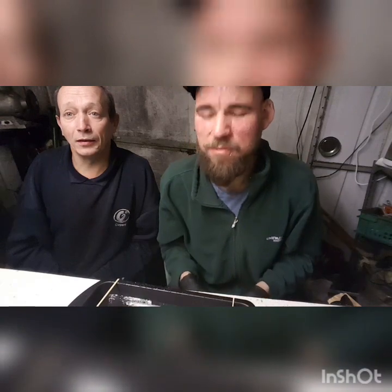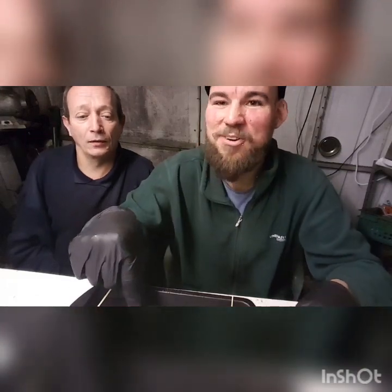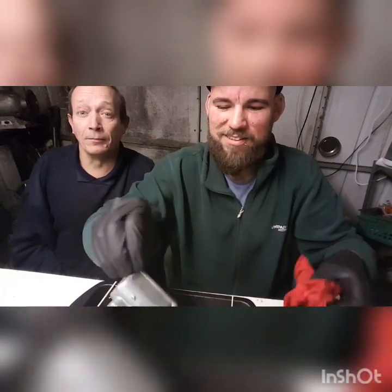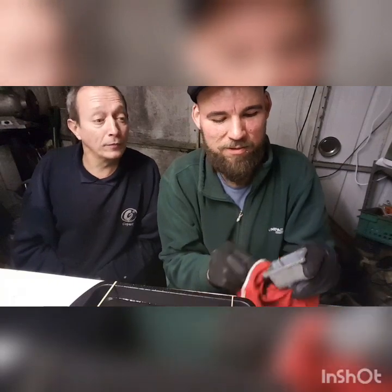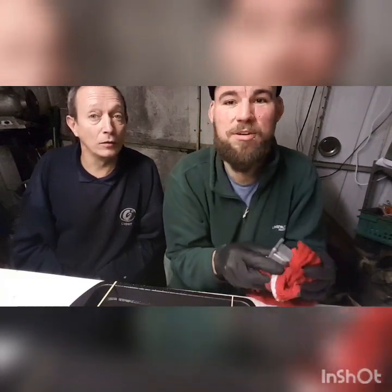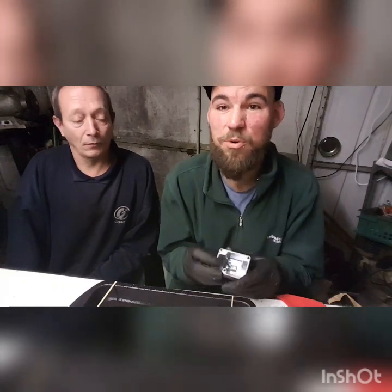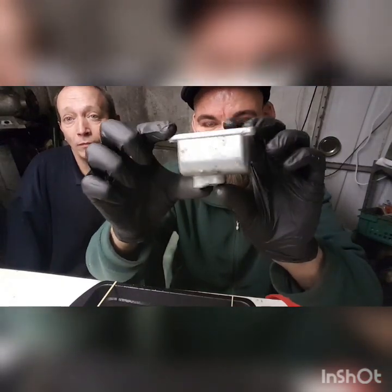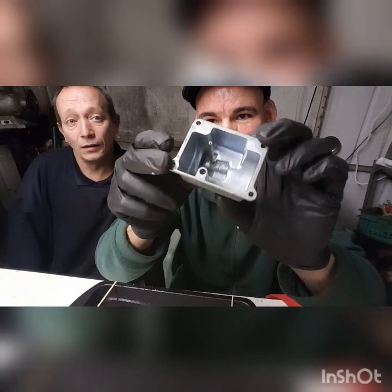We're about 25 minutes in now. It's quite a quick process, but if you want something done you'll have to wait for it. We're going to turn the massager off now. That sports massager has been running at a moderate speed — it is variable. Also watch which one you buy, because some take unusual batteries. Ours just take standard double A. But check out these results — look at that float bowl now. Like new. That is 25 minutes at moderate speed on a homemade sonic cleaner.